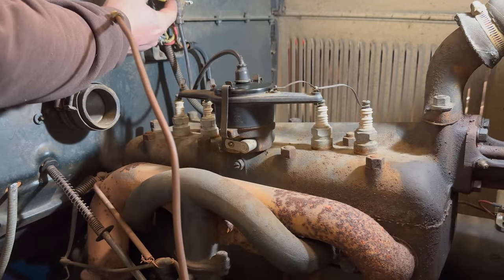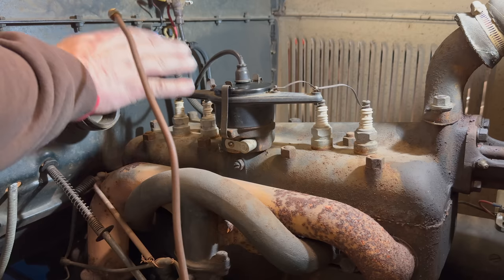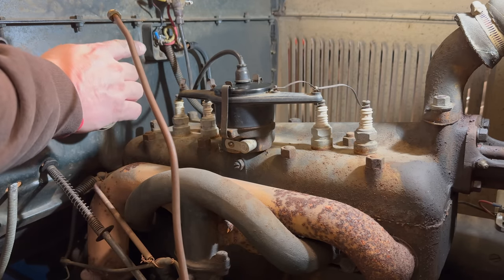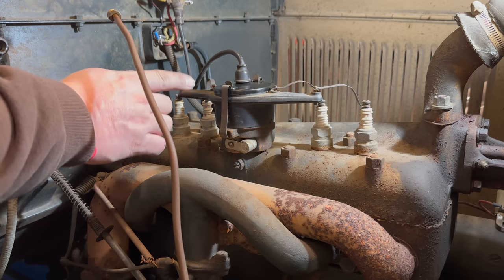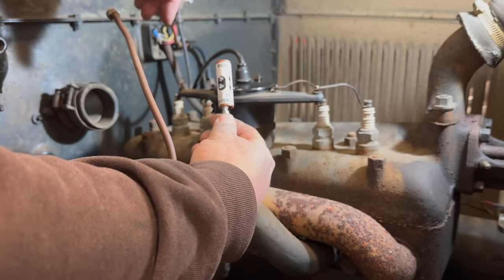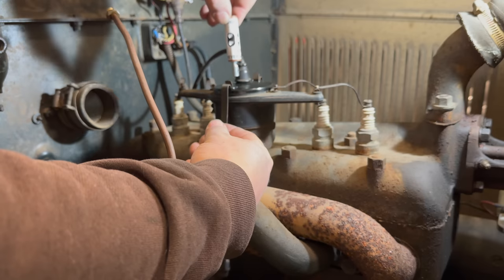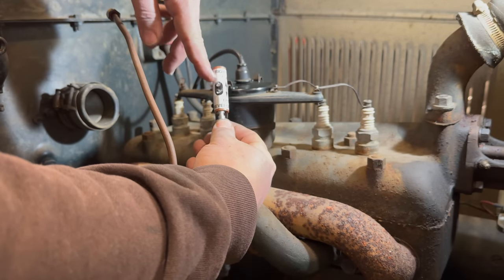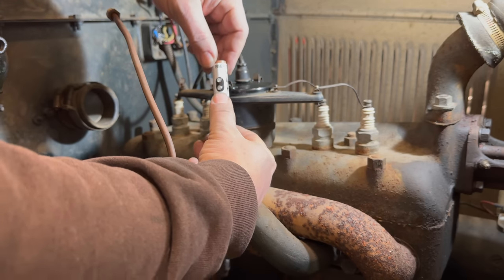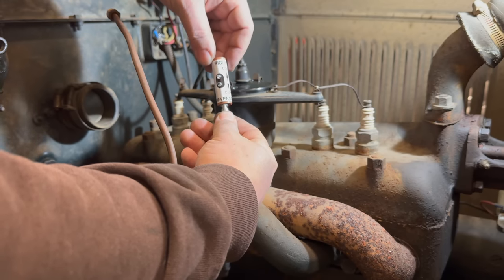Now the coil is really hard to read — it's difficult to tell which side should be negative and which side positive. I'm pretty sure I have it right, but in my last video with an MGA I showed how a coil being hooked up backwards can really affect how strong your spark is. So today I wanted to show off a little tool: this is a coil polarity detection tool. I'm going to put it right here at the distributor cap — if it's hooked up correctly, the light on top will flash when we crank it over, and if it's reversed, the light on the bottom will flash. This lets us verify whether our coil is connected correctly.